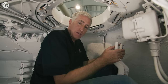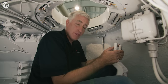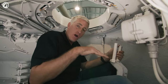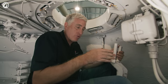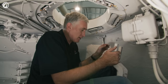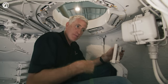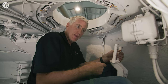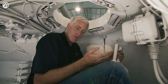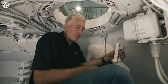Now, how much braking do you think a 95-ton vehicle needs when it's going downhill? Well, the manual has an answer for that. You use the accelerator. You put this thing on the edge of a crest, and the Pershing would do this as well, holding it on the edge with the brakes. You put the vehicle into reverse, you let go of the brakes. The vehicle will now start to roll downhill, and you then use the accelerator to retard your movement, because you're accelerating backwards, providing basically reverse force to the gravity that's sending you down.